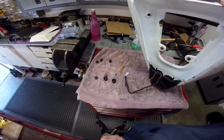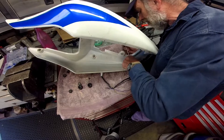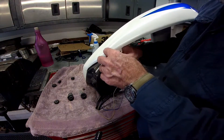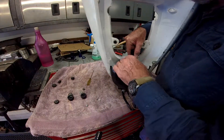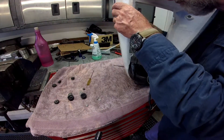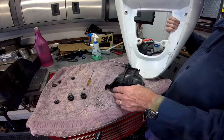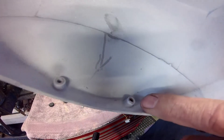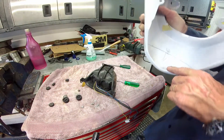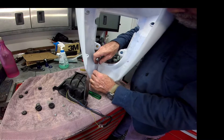The tail light assembly was held in by four screws, which I undid, and the unit was removed. The screws that hold the tail light in place go into captive nuts that have been moulded into the tailpiece. In the new tailpiece, one of the rear ones had suffered an overflow of plastic blocking the thread, so I ran a thread tap down it to clear the obstruction.